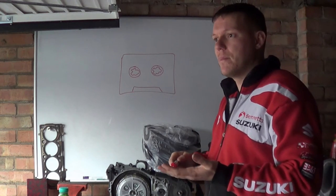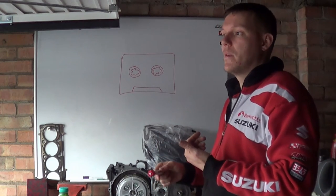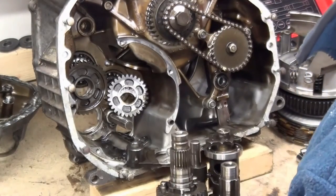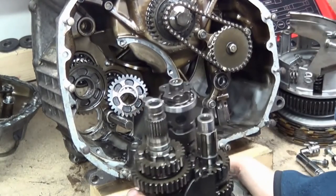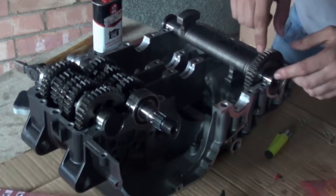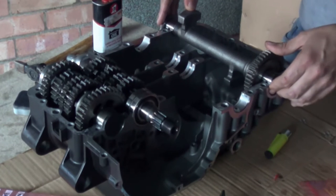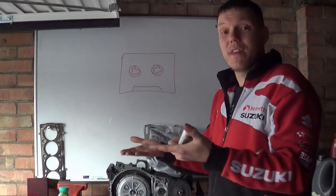We'll have a quick run through of the differences between a cassette gearbox and a standard gearbox — what's beneficial, why they cost more, and why they aren't everywhere. I've got two video clips on screen: one is the CX500 engine, a 1970s motorcycle, and this is basically what a cassette gearbox is. You can see the entire gearbox can be removed as one assembly on a bearing carrier that holds all the parts together. The other video is the ER5, where the gearbox — both shafts, the selector drum — are integrated into the casings, and the centre line of the input and output shafts is where the engine split actually is.